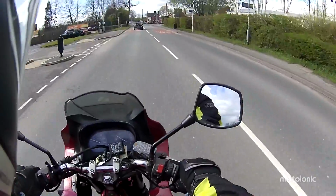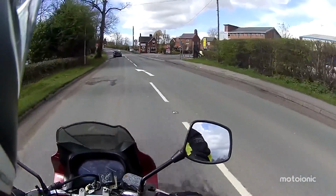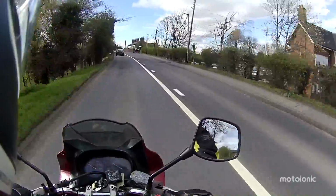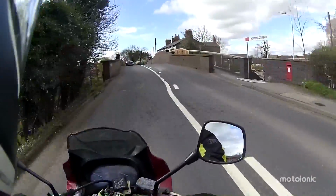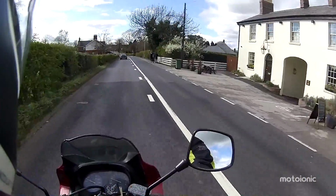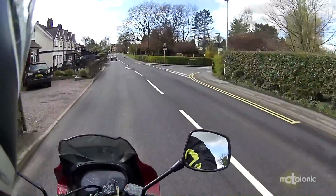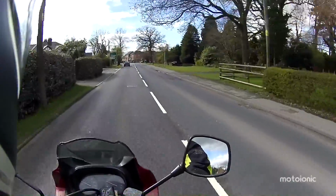So I got the bike back. That was an interesting few hours on Friday morning. Little repair. Got a good charge on it now. Just above idle, even with the headlight on and the hazards flashing and everything, we've got good charge rate. So I'm quite pleased with that.